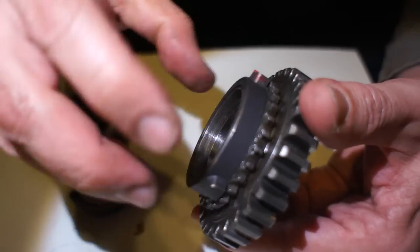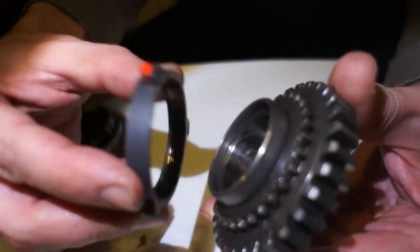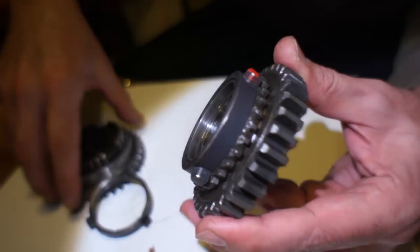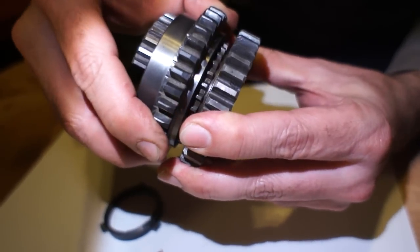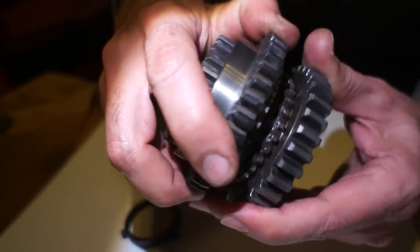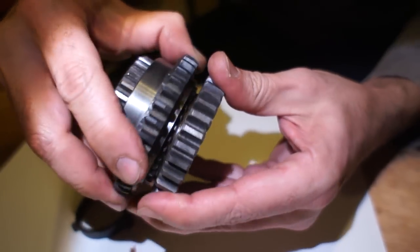With no gap, this thing just basically freewheels on here. There is no contact along this cone or this inside edge — you can see how these are really kind of one flat surface. That causes it to not have enough load to bring the gear up to the right speed. So what you have is a shift — we'll exaggerate here, we won't be able to duplicate it because we're not spinning it with an engine — but you get a hard sort of grind because the gears are not going the same speed. This gear physically has to grab these teeth as they're spinning at different speeds. That's what you get when it's a crunch shift — these teeth are just having to physically crash together.